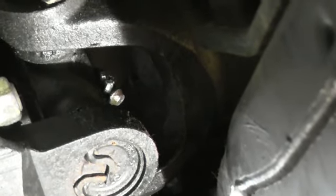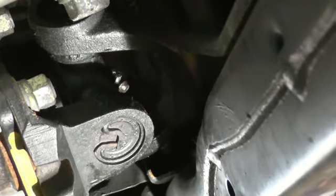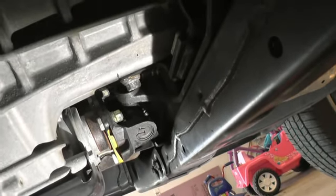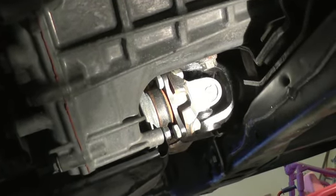This second fitting is one of the hardest ones to get to and grease because there's not much space — there's a cross-member beam right there and everything is super tight. So take your time, don't rush it. The grease fittings should be cleaned off of any dirt and old grease, otherwise you'll pump all that dirt inside and your U-joints won't last long.